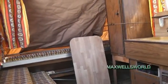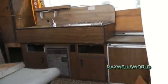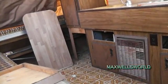The next area on the trailer that's always a problem is the cable lift system. What they rely on to winch them up is basically your standard, what they call aircraft cable. It's that braided type of line. I don't have a piece around to show you, but over time that stuff gets all rusty and it'll actually break on you, or if you've tried to crank it up with it latched down, the strain alone will make it snap.